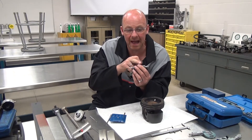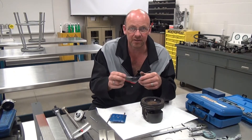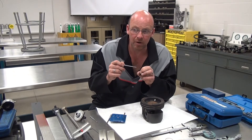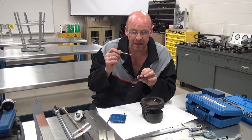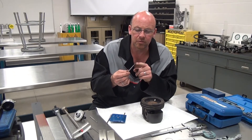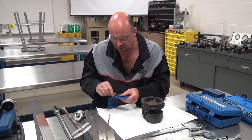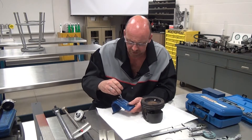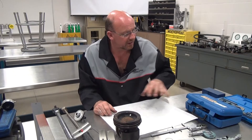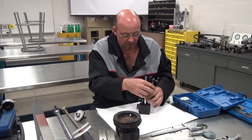The tool tells you what it will read up to, then you take the dimensional value and read the actual value of that particular hole. Some manufacturers have oil return holes in the piston, and the only way they can be checked is to either use jetting gauges — which are for carburetors and small orifices checked for airflow or fuel flow — or to use small hole gauges. So again, picking the right tool for the right job to get the value, not just guess at it.